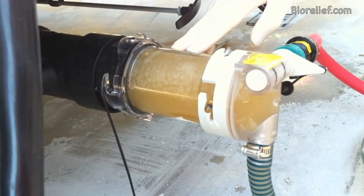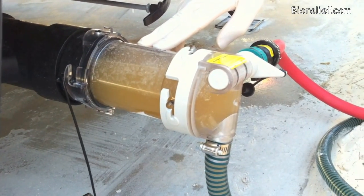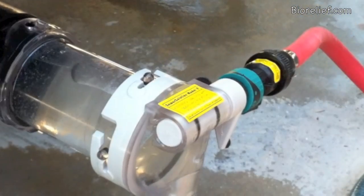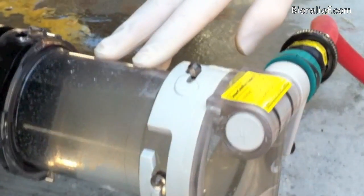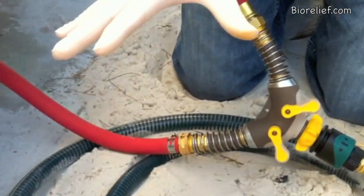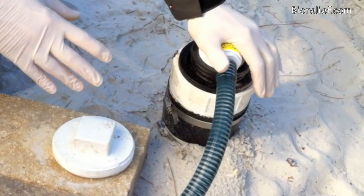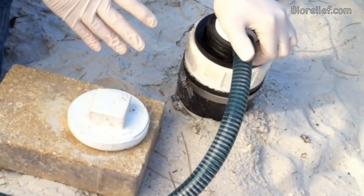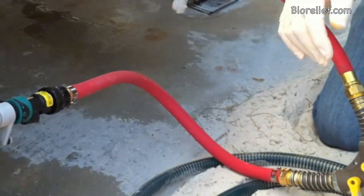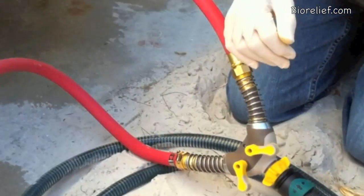You can see the water is getting clearer and clearer. As we started off it was brown, now it's getting clear. You can keep doing this until it's absolutely clear, then your tanks would be perfectly clean. That's how you clean these out. You can see how clean this is now — the water that started off brown is completely clear. And not only is the water clear and the tank clean, but also the Sewer Solution itself is clean. I might note that we're in a Florida campsite here and there is no smell whatsoever. This sewer pipe has a water trap in the bottom of it, so you don't smell any sewage — all you have is a little bit of water on the bottom, and this is perfectly clean. I can remove all this and not worry about having a disgusting stinky slinky or a three-inch pipe. Everything is now clean and done, and that is the great thing about the Sewer Solution — it's self-cleaning and a relatively quick process.